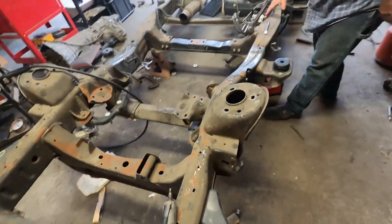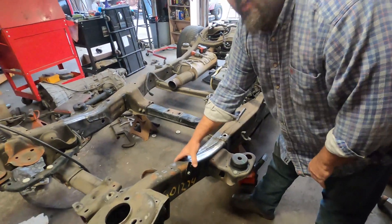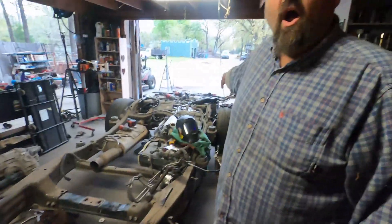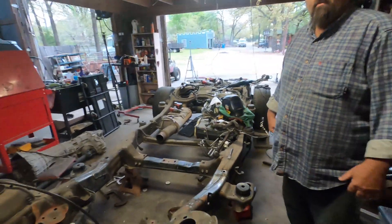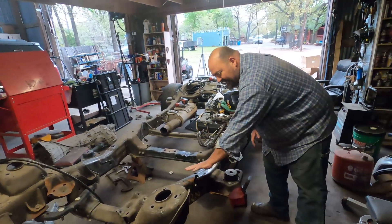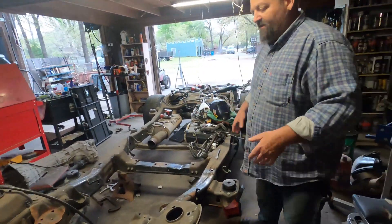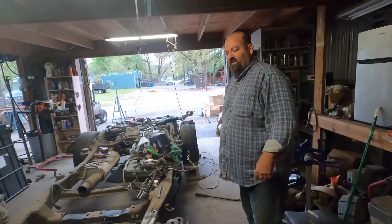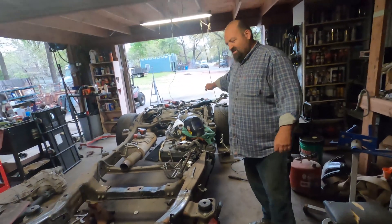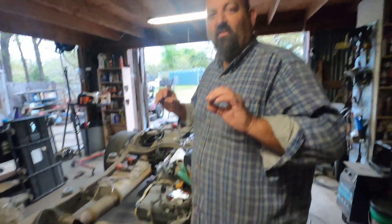This is all another piece. When we took this piece off, we sliced all the way through the old piece to get a nice clean cut. For the other piece, we bought this section from a junkyard off a non-wrecked vehicle and peeled it open to avoid damaging the section we needed, so we had nice good pieces to put together. Cory figured out to use the winch on his four-wheeler — we were trying to push it in but it wouldn't go, so we winched it and it just sucked right into place.